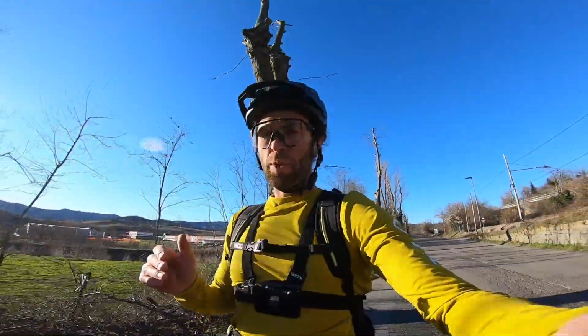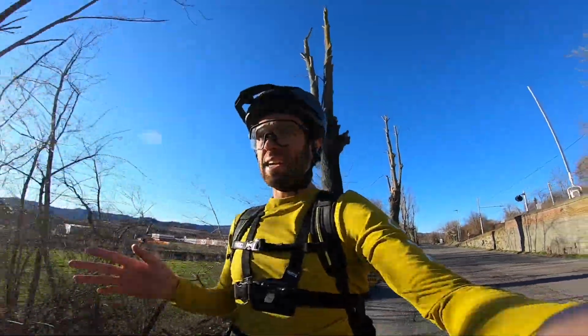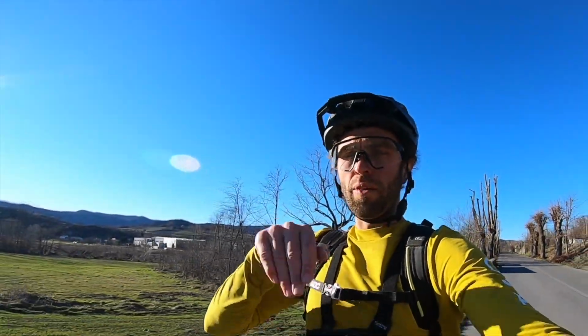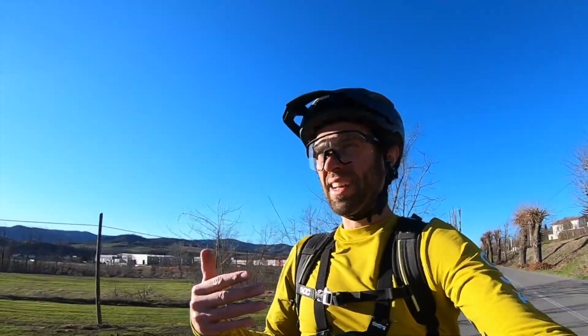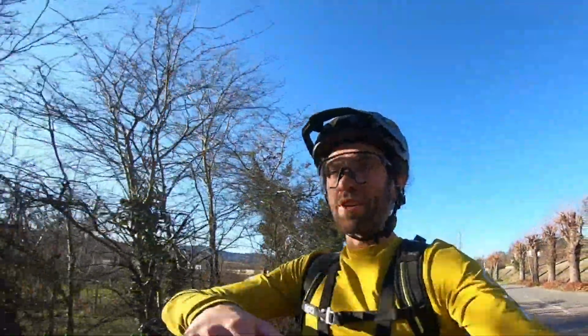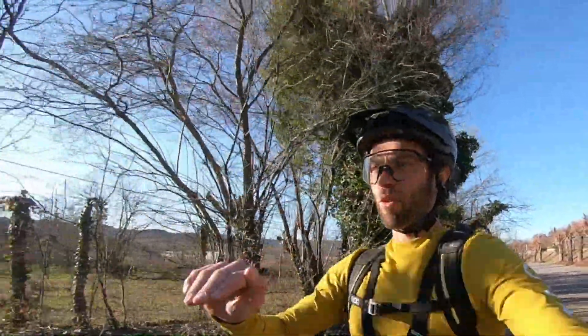So, main points to make: good reach number, I think it's 495 as standard, with a 2-degree angle set. It's about 62 degrees with a 30mm stem, 16-degree back swept bars. Everything at the front of the bike is getting the front wheel axle out ahead of you and bringing your hands back behind it. So this gives you more confidence in steep stuff. Under braking it will help keep your front wheel out in front of you and push against the force of your body going forward as you brake.